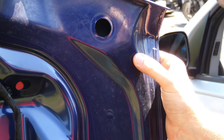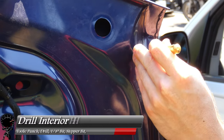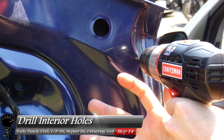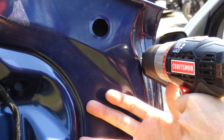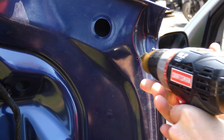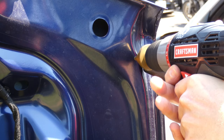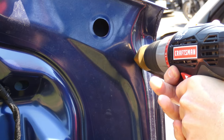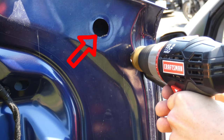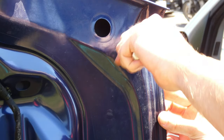Now let's go ahead and open up the trunk and work on the inside. This one is double-layered, so we're going to have to grab our center punch, then our 1/8-inch drill bit, and then our stepper bit, and create a bigger hole just so we can get our screw through and tighten up that spoiler to our trunk. Now some vehicles may vary, but for the S550 Mustang you will have to do this. Then move up to the stepper bit. This doesn't need a specific size — just big enough so you can get your screw through; you can make it as big as 3/4 of an inch up to 1 inch. It's going to be very similar to the hole right above it. Once that hole's big enough, let's grab the deburring tool and clean up all these sharp edges.